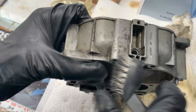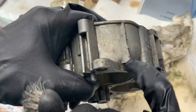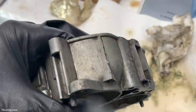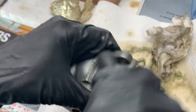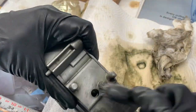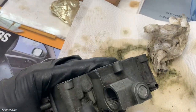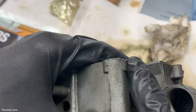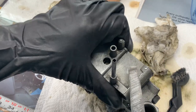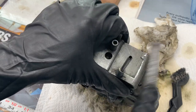I'm going to run a tiny little drill bit through all the little vent and fuel pickup tubes. You can leave the fixed ones alone — you don't have to remove those. This one needs a bath now — in it goes. It's a dirty job but someone has to do it. If you really want to make it look better, you can even take a file and carefully dress these rough casting areas a little bit — but that's only if you're super picky.